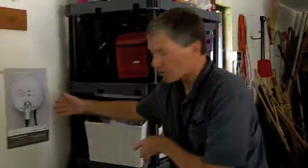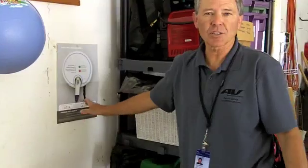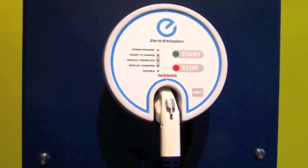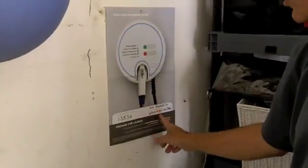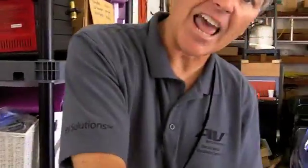The thought here is that if you were to get the cord tangled up around the front bumper, you want it such that when you back out, it pulls the cord right out and doesn't cause any damage. There is a safety feature built into the station — it's made to come out, and as soon as the cord is pulled down, it opens a relay, shuts the power off, and the cord will pop right out. This cord is never energized until you actually plug it into the car and latch it.